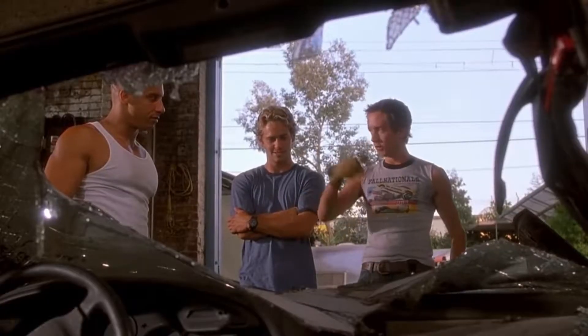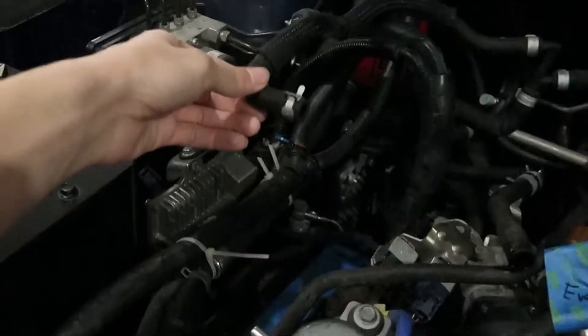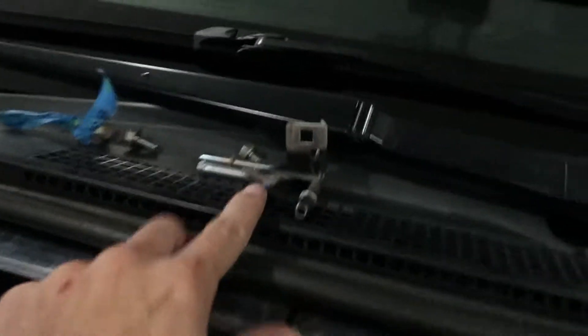I kind of spilled some gas but that's okay. We had to stop — I can't put the manifold on yet because I don't have an EGR delete. I ordered one from IBR with one-day shipping, so overnight parts from Japan. The manifold is all assembled over on the floor. Right now I'm doing some hose management — the evap is cut off to the Y that IBR provided. There's a hose I'm not sure about but I know where it goes, and then there's one from the AOS that also goes to the manifold. I've got the throttle body hoses set on an L-clamp, and I removed the fuel line from the old bracket that was on the stock manifold — you can just take it from the firewall and connect it up, which really simplifies the system.